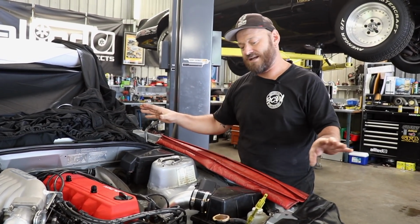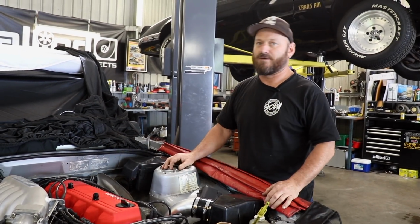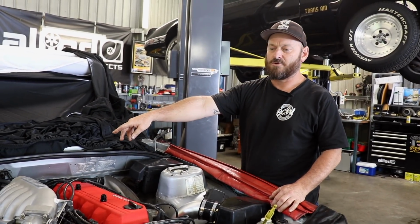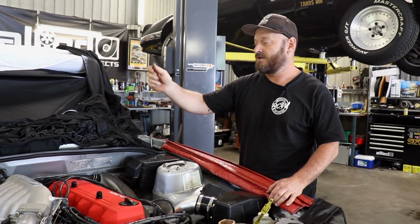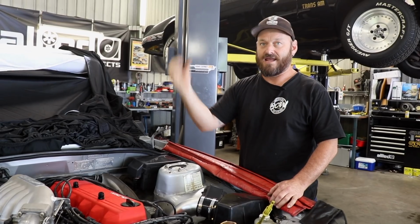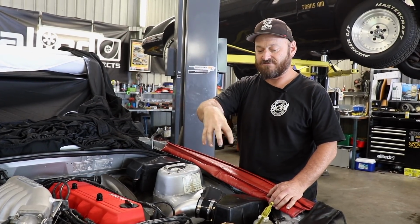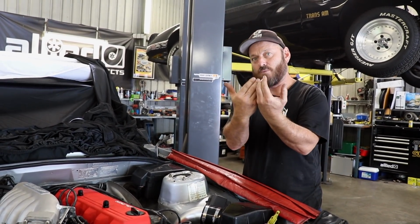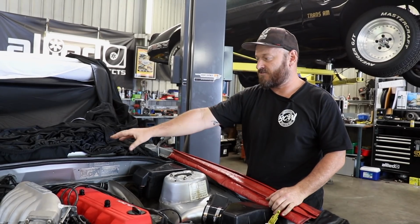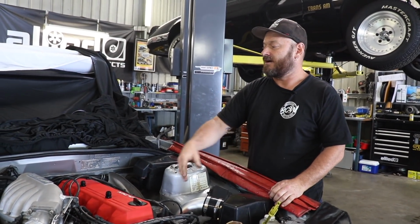If you've got it all drained out, everything ready to go, when you fill it, don't seal the system up. Take off the highest point hose, usually a heater hose, take one of them off the firewall. That's going to let air exit the system. If you don't do that, it'll take you ages to fill it up because air bubbles will have to keep coming out where you're trying to fill it. So hose off, start filling, it will go in quite easily.